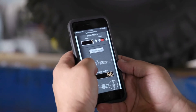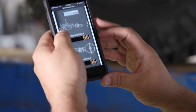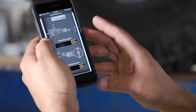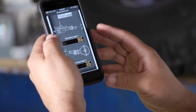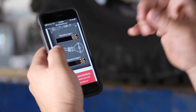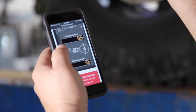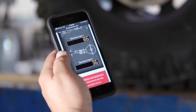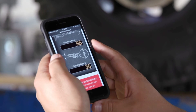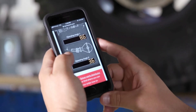So when we calculate our results, you can see that the angle up at the transfer case is 8.6 degrees, and that's where the double cardan is, which can easily handle 15 degrees running angle all day long. And the U-joint at the axle is only 3.6 degrees — as long as you keep it under 7 or 8, you can run all day long.